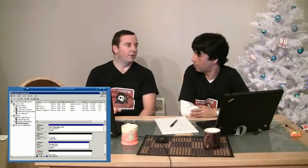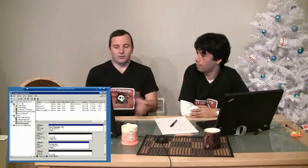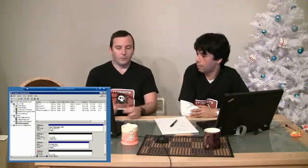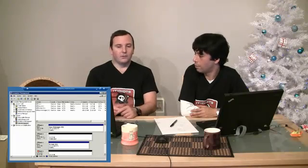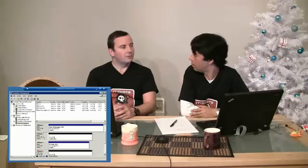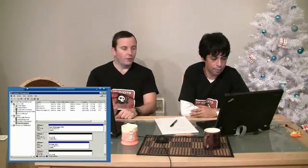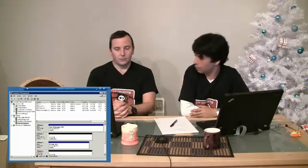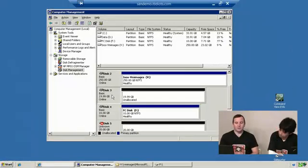I didn't tick the MPIO option there, so it doesn't group the disks together. It just sees them via different network cards and sees the disk twice, so it thinks it's 2 disks. It's not got the intelligence. But when the MPIO looks at the disk signatures and all the disk information, it realises they're the same and puts them together. Gotcha. But I can sort that out later on.